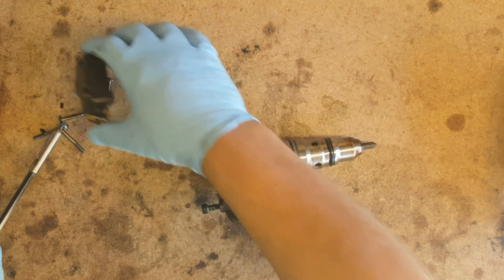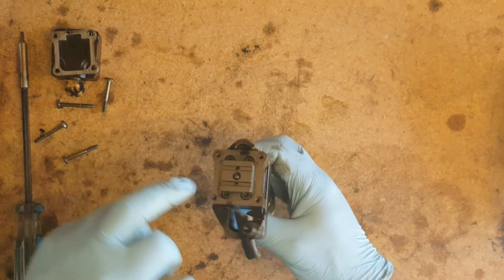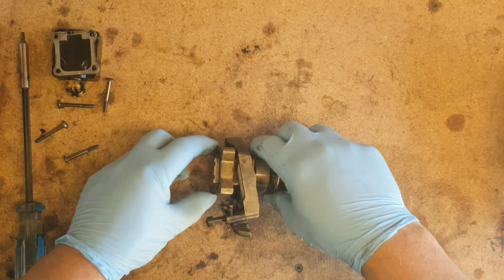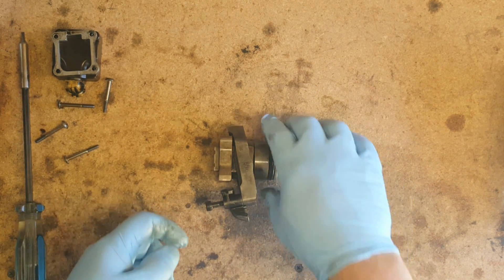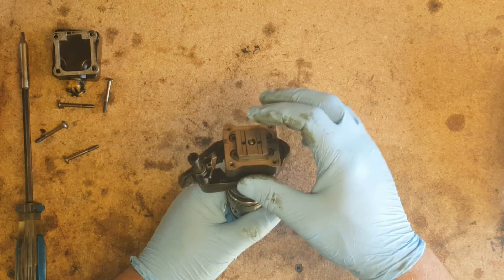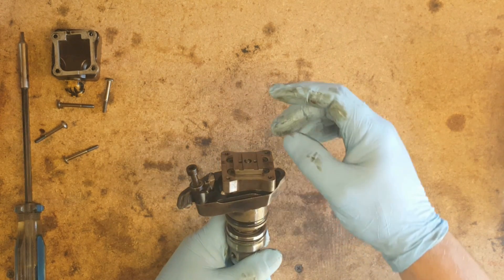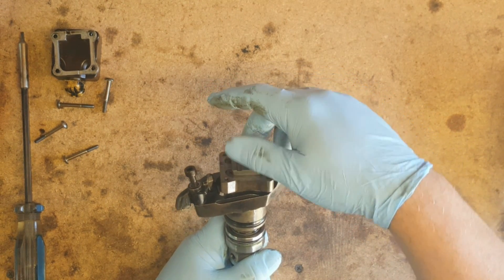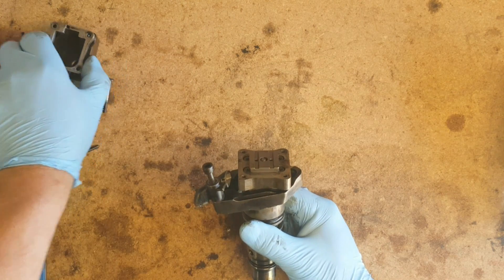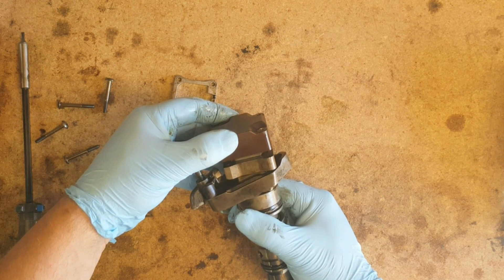Once the screws are out, the solenoid will come right off. There's a spacer that also needs to come off so you can get a feeler gauge under this armature plate. The armature plate is here and the poppet valve body is here — we're going to check the clearance between the two. Through normal operation as the injector runs, the lower seat in the poppet valve wears, and as that happens the clearance between the armature plate and the body gets less and less, causing a misfire especially when cold, when it gets down below about one and a half thousandths. The oil trapped under here creates a suction and when the solenoid energizes it has trouble overcoming that suction, particularly when the clearance is tight.